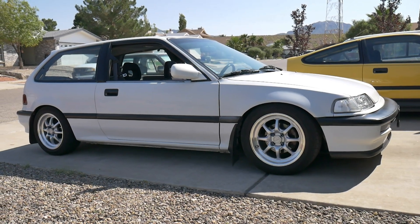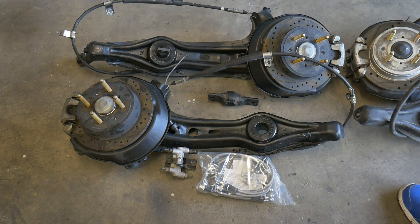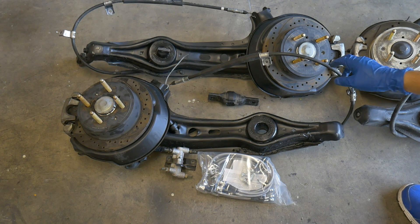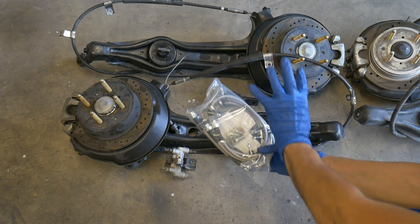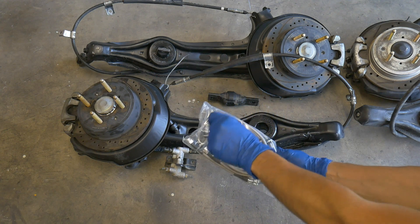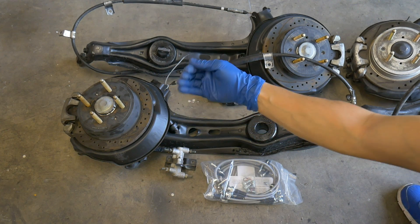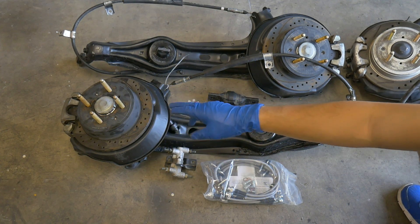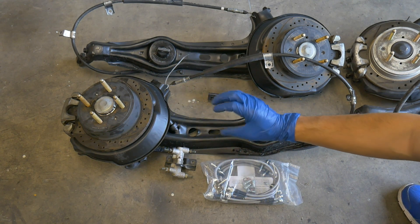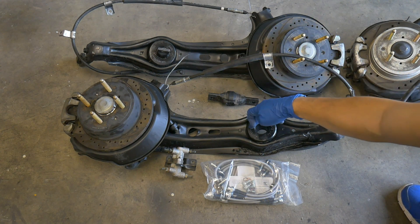Welcome back. Today we're going to work on a rear disc brake swap. The parts you're going to need are the entire trailing arm assembly — make sure it has the e-brake cable and brake lines. We're upgrading to stainless steel, but you do need them because your drum brake lines will not work on these discs. Make sure you have the caliper and all the bolts and hardware that attach it to the trailing arm. Brakes are optional — if those are still in good shape on the trailing arm you get, you may or may not use them.